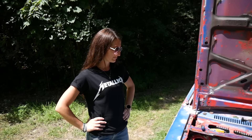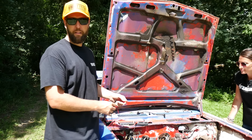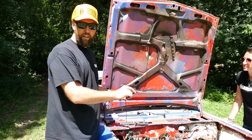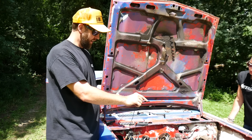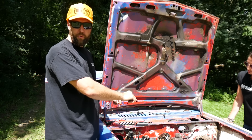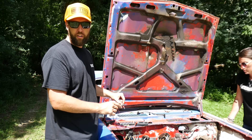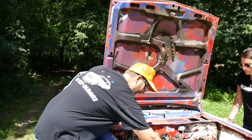You got her all done? Got it. This is mind-bottling, but I'll get through it. I'm going to grab a ground off the engine head, since that's where the distributor is seated into. And then I'm going to take my positive to the starter relay and see what kind of voltage we've got here.